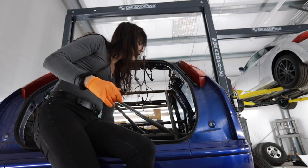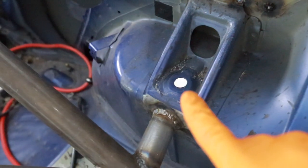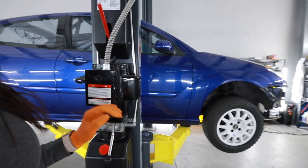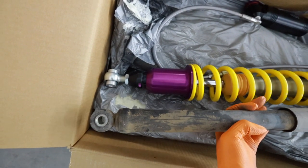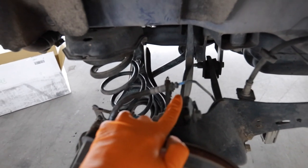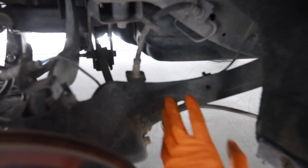Why does this car have such weird sizes for everything? And that's why I lowered the car down, because I knew that thing was just going to go bon voyage once I took that 13mm nut off. That's going to be a close one whether it's going to clear that upper control arm because that spring goes pretty far down. Look how wafer thin this upper control arm is — it's like made out of paper. And this is the part that actually snapped on Richard Hammond's Focus RS on the last episode of the Grand Tour, so we already know this is fairly weak on these cars.